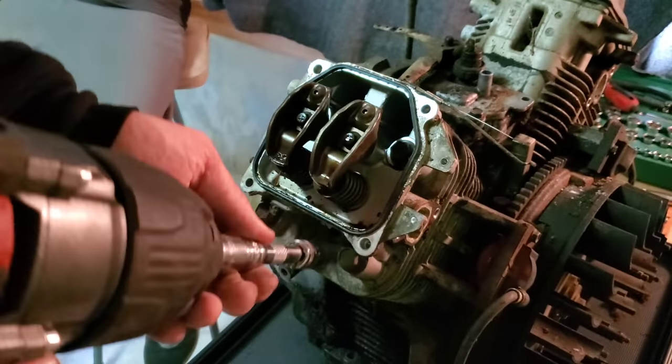There we go. All of that is hooked up. So this rod right here, this goes across and this goes to the choke. This rod right here comes across and that goes to the throttle. So all of that is moving. And one thing I like to point out to people is that almost always your throttle will have some little spring on it. The choke will not. That's one of the easiest 5 seconds, you know, 99 out of 100, that's going to be the way it is: choke has no spring and throttle has a spring.